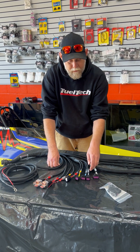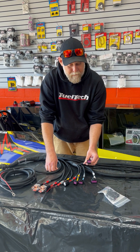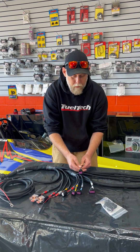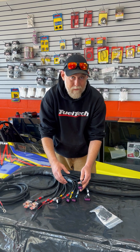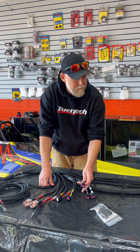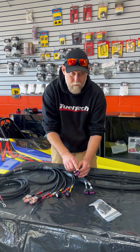The gray connector is ignition outputs. If you're going to use a FuelTech smart coil harness it's going to plug directly into this, and that's pretty much going to be the end of that. Blue is ground outputs — you have two options with this. If you're going to run two sets of injectors it would be based off of this plug here.